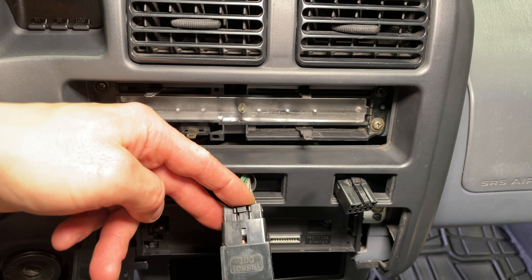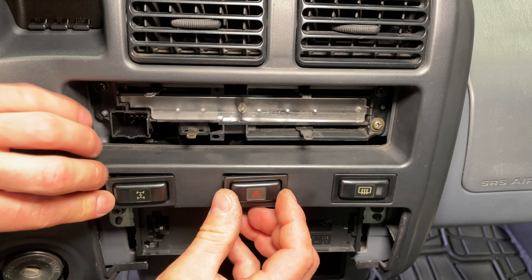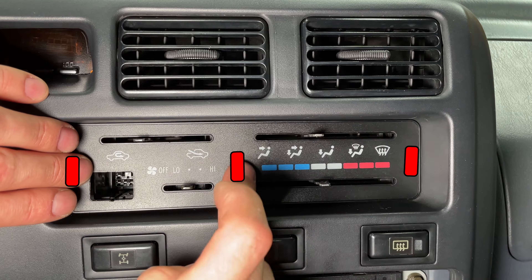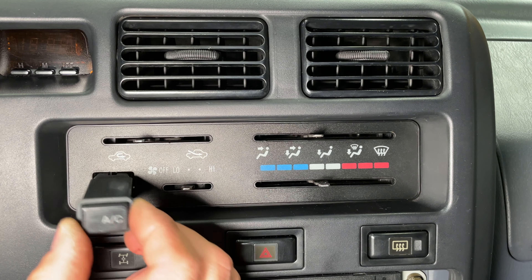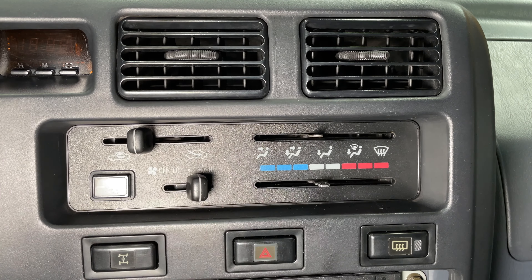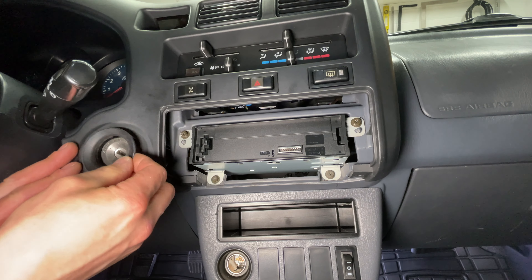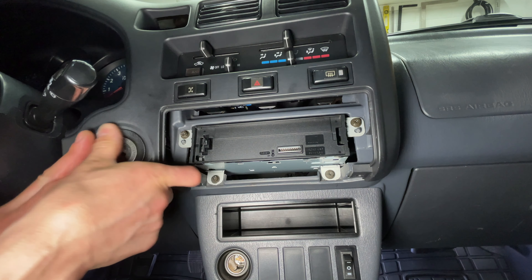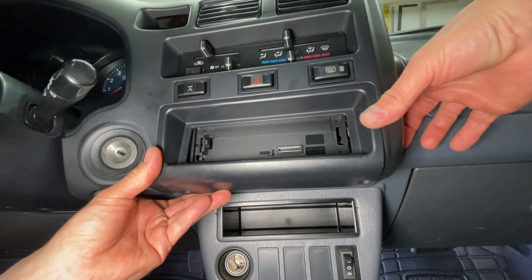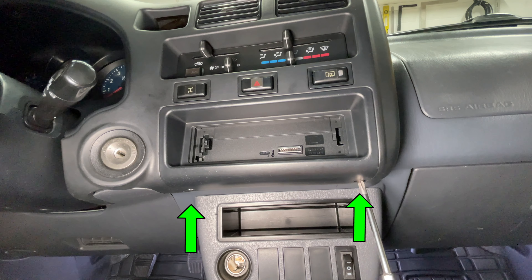From left to right, plug in the center locking differential, hazard flasher, and defroster switches, then push them into the dashboard. Reinstall the climate control trim bezel and push it straight in to snap it in. Push the AC button into place, then install the knobs. Install the rubber ring around the ignition switch with the cutout slot facing up. Pull the lower right corner of the plastic toward you so the top part of the radio trim can fit under it. Install the last two screws and the radio faceplate. That's it!